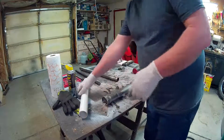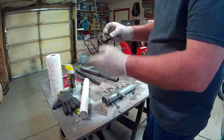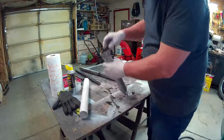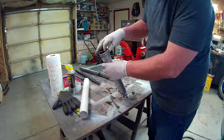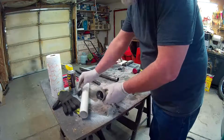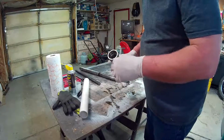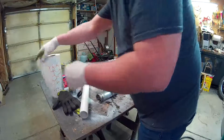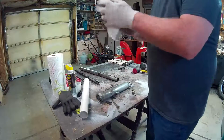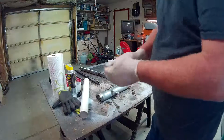When you put the new rings in, there's going to be a flat side and a beveled side. The flat side's going to go down like this, right? So the beveled side would be here, right? On these particular forks, it doesn't matter that much, but that is what they recommend doing, so that's how I'll do it. And then we'll get into this. But I'm going to take a quick break. Get some coffee in me, and then we'll be right back.